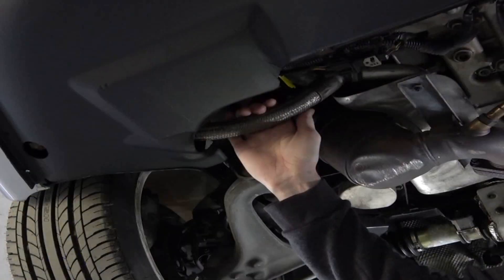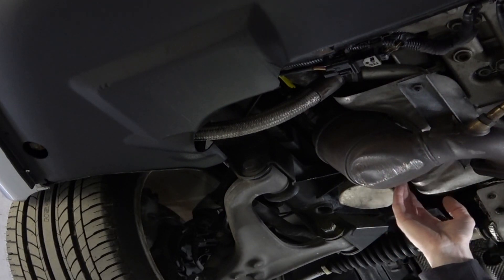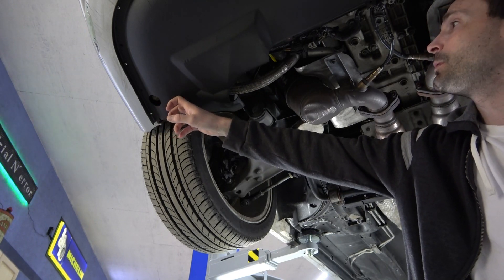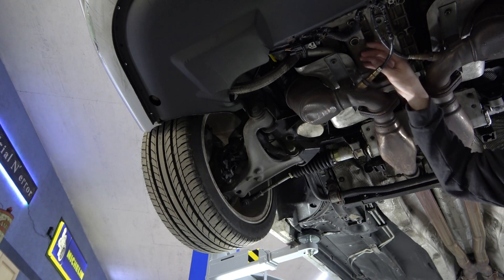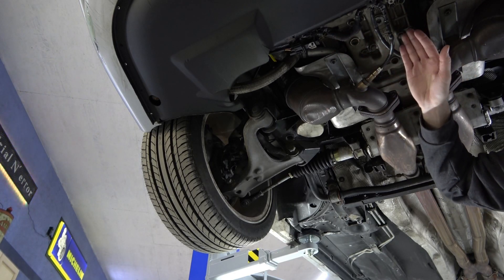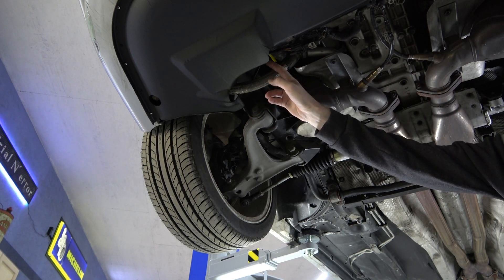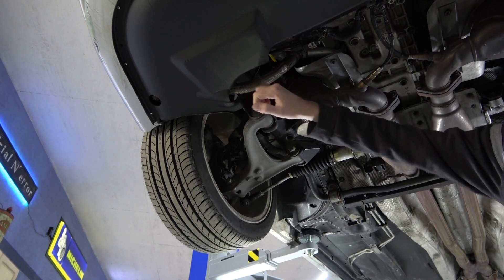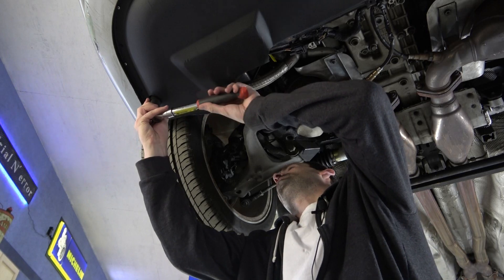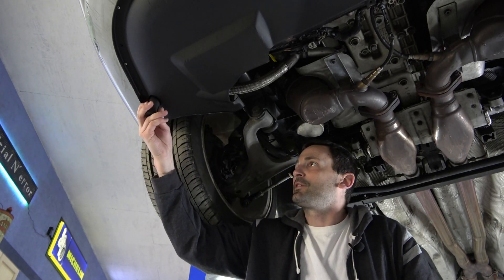This big braided line you see here is the oil feed from the reservoir — it loops around and ties into the external oil pump off to the side. What's really different from a normal oil change is that you have to drain the bulk of the oil from this reservoir. The bottom of the engine, which would normally be a pan, is all part of the block — all aluminum — with an additional drain for whatever small amount of oil sits there. The bulk of the nine-or-so quarts is all sitting in the reservoir.